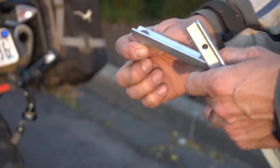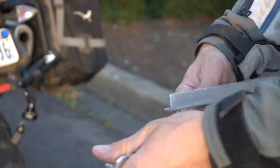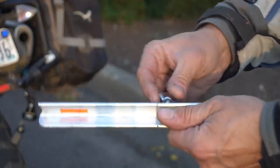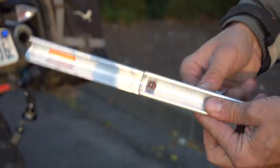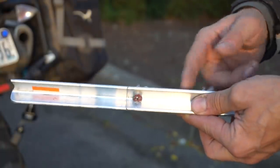To make a substitute for my center stand, I have two pieces of aluminum angle iron and I have them set up right around 15 inches in height when they're bolted together. That'll allow me to get the back wheel up off the ground so I can access the chain to clean it and to adjust it, or at least to check the adjustment.